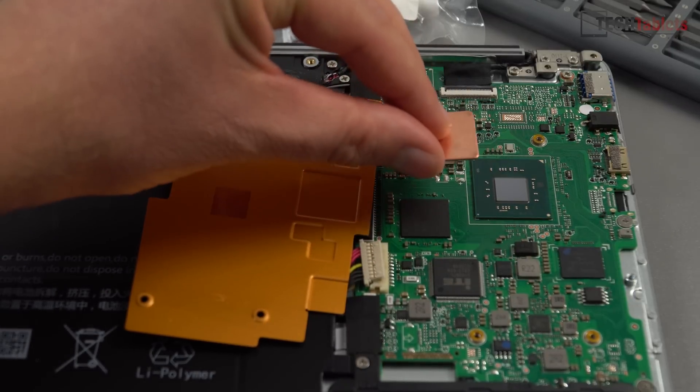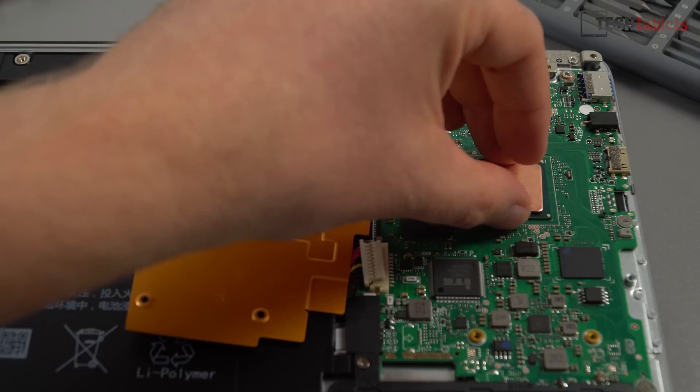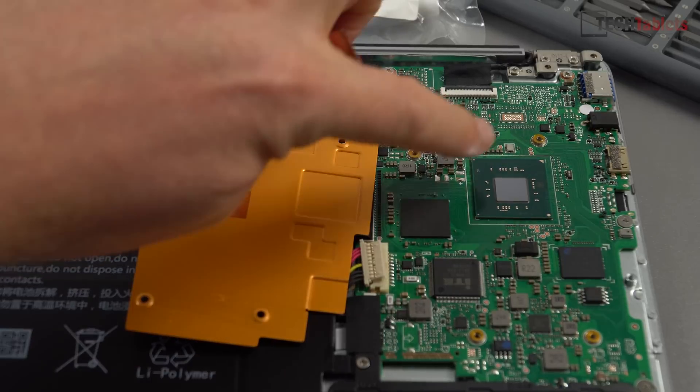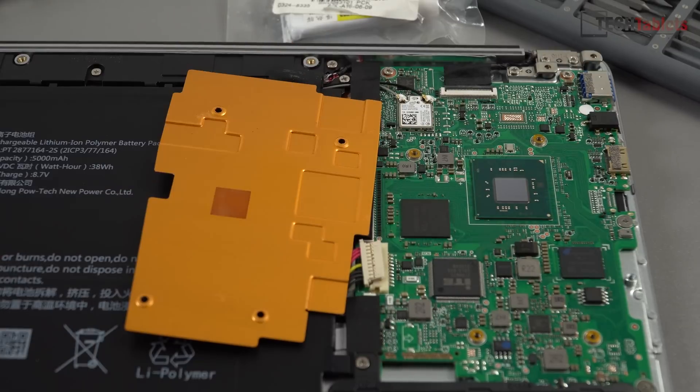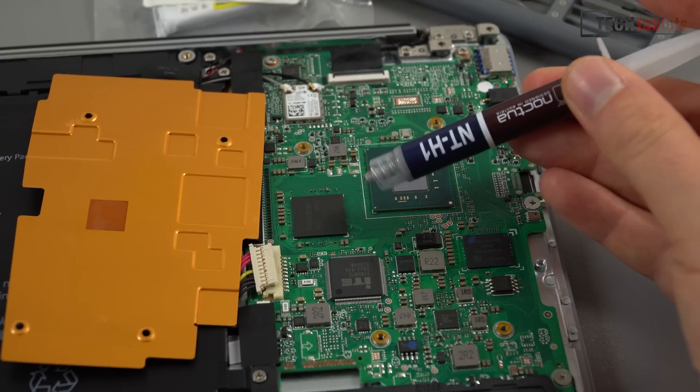You should probably go with 15mm by 15mm or smaller. The thickness is one millimeter, going right on top here. Now, there are resistors nearby that are quite close and could cause a short — you can put nail polish over the top of those. I'm not going to be that cautious because I've done this so many times and never had a problem. As long as you put a bit of thermal paste on there, there's about a millimeter gap between those resistors and the shim, so they shouldn't come into contact.